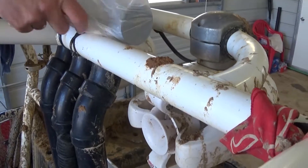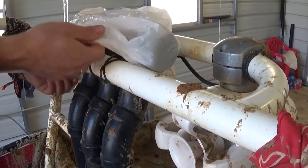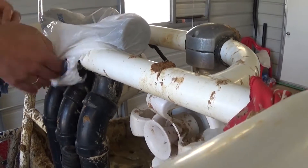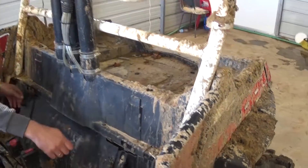The air intake is on the top right there, so what you want to make sure is you need to put a plastic bag or something to prevent water going inside of it, because that's the air intake. And if you fill it up, it won't be a good thing — you might water-seize the engine.